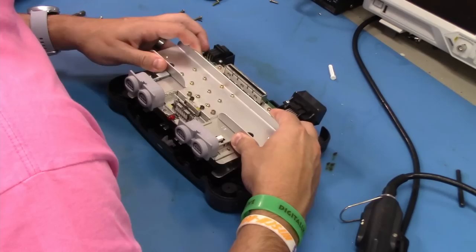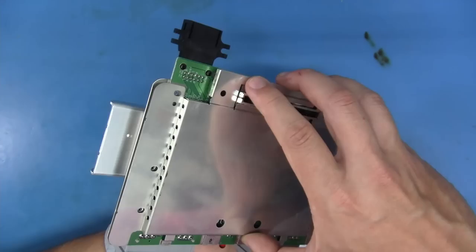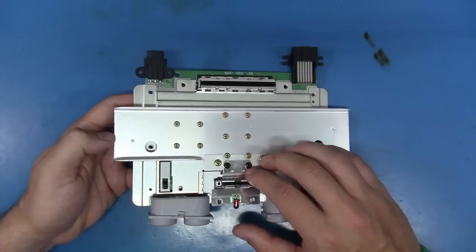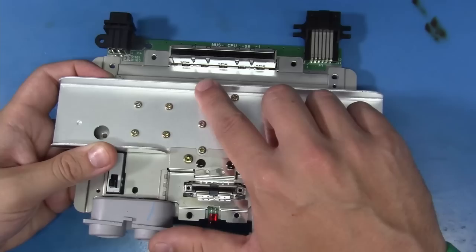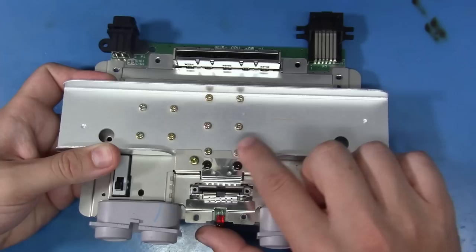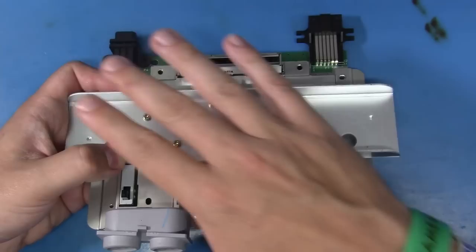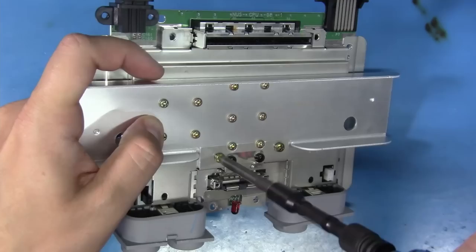I'm just going to lift the main board out — there it comes — and we're going to gather all of our screws and put them in an area so we don't lose them. Our main board has been liberated from the bottom shell. Let's go ahead and take the bottom RF shield off and discard it for now. The objective now is to remove the top RF plate and heat sink so that we have full exposure to all of the areas we need to directly solder to. I've seen a lot of people on YouTube thinking they must remove all of these screws, but you don't. There are only two screws required, and they have lock washers underneath them. Simply zip them out and I'll show you how to carefully and delicately remove this assembly from the main board safely without damaging anything.